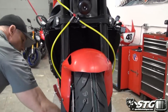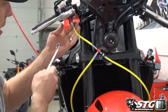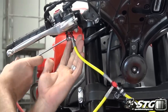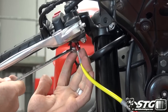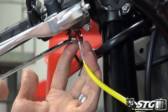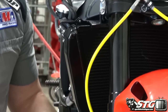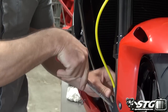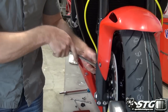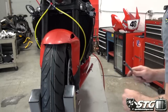A 14mm wrench is what I'm going to use to tighten up each of the banjo bolts. All aluminum here — aluminum fittings, aluminum banjos. You do not need to go wild on these; put a reasonable amount of torque and then stop. Do not overtighten. Lightweight components here.